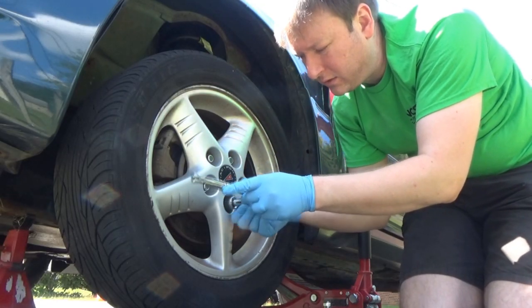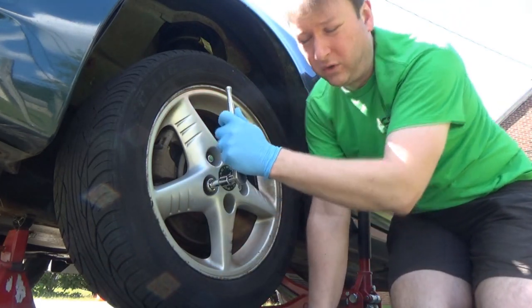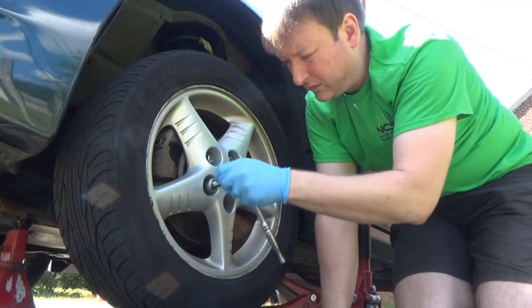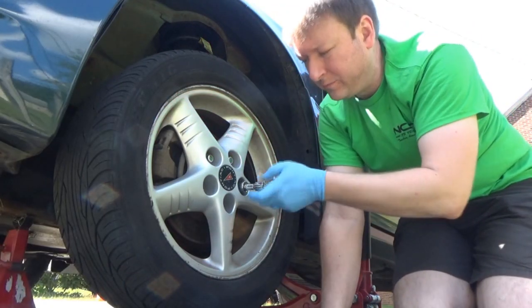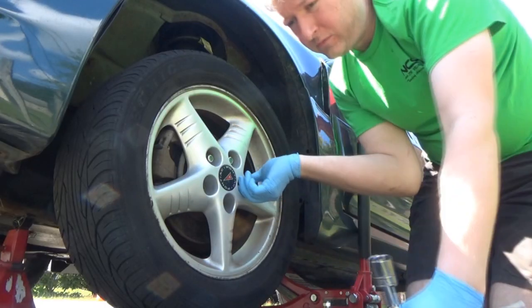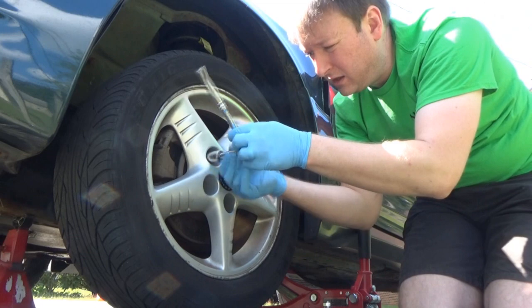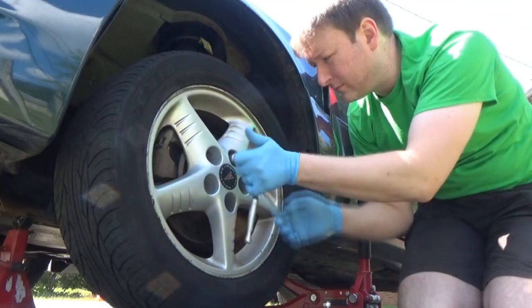Like I said, the best thing to do is to replace the sensor or hub completely, because even if this is fixed and we do get readings, there's a chance that it's gonna start throwing other codes, because maybe there will be interference from something else, or even adding new wire might cause some issues. I don't know, but we're gonna see. We're gonna take a chance.